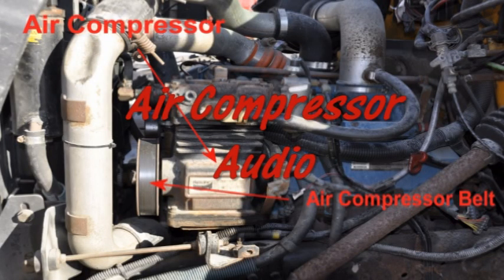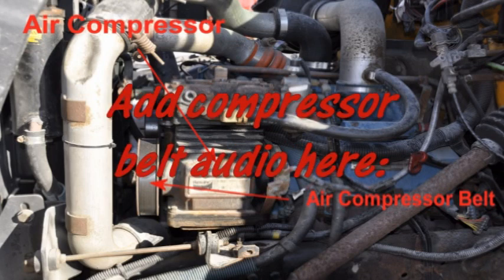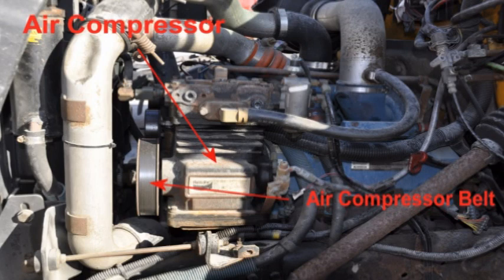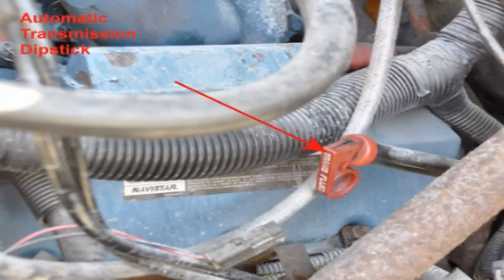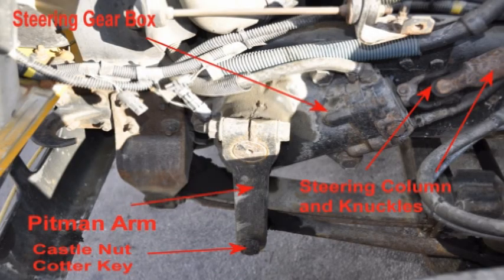Move around to the left side of the engine compartment. Check the air compressor to ensure it is operating properly, mounted securely, and not damaged or leaking. Hoses and connections should not be leaking or show signs of damage. Check that the air compressor belt is not dry-rotted or frayed and has no more than three-quarter inch free play. Check the automatic transmission fluid level by removing the dipstick, wiping it clean, reinserting, and removing to assure the level is between add and full — this check must be performed with the engine running, so you only need to describe the procedure. Check the power steering reservoir to be sure the fluid level is between the add and full marks using the appropriate cold or hot markings.